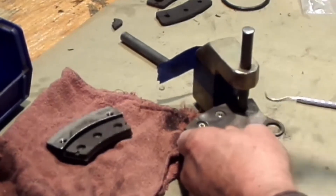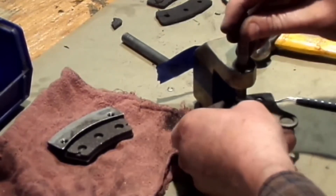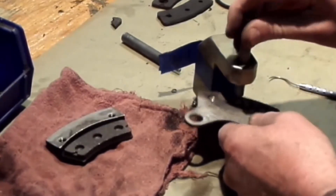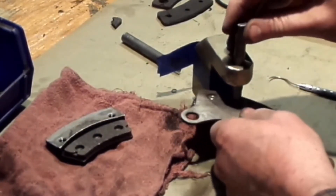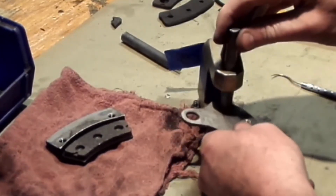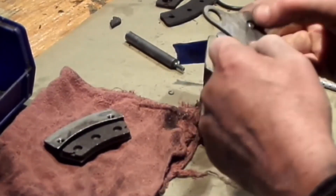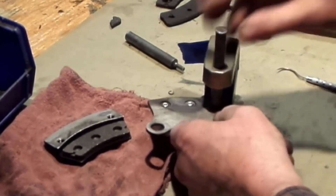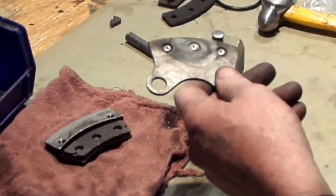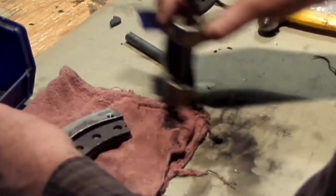You'll see that the lining is wobbly, so now I need to buck these the rest of the way. I'm going to give these some pretty good hits. Be aware that we can break the lining if we go full gorilla mechanic, so I'm doing it a little at a time — hitting slightly harder, driving a little more, not a lot. I'm checking these rivets to make sure they're driven all the way. Now I'll put my pick in there to see if the rivet wobbles — if it's tight all the way, then I'm done.